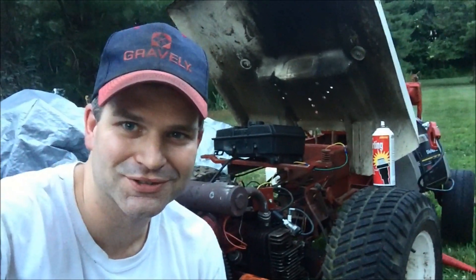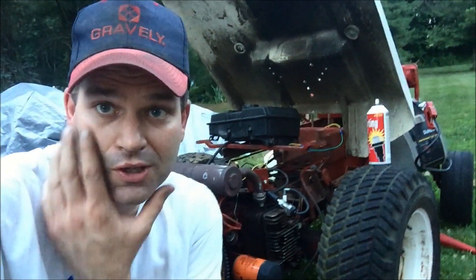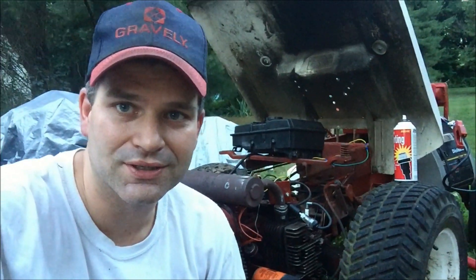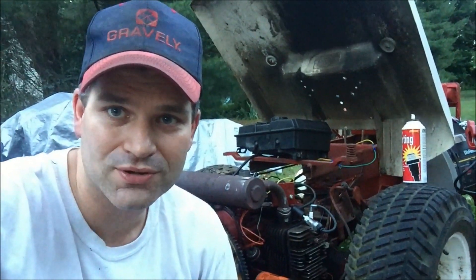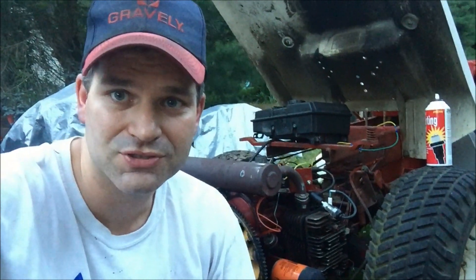This thing was running — you all saw it. Now I've got no spark at all. The plugs are wet, I just checked them, and that's a good sign — maybe the intake manifold wasn't sealed right before and it wasn't sucking any fuel in. But we crapped out because we lost ignition, not because of fuel.